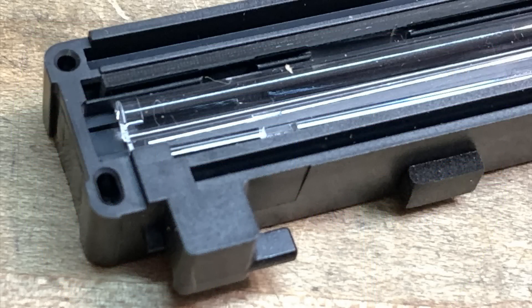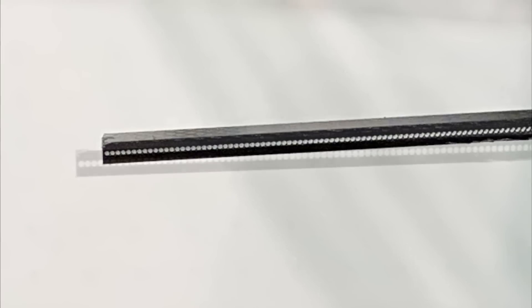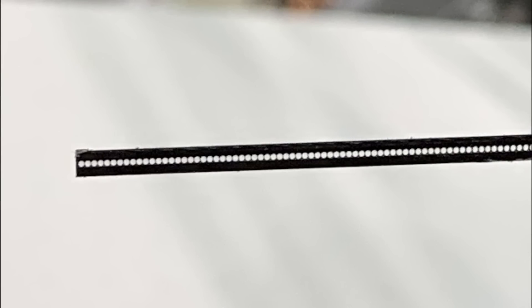If we take a look at the optic side of it, we will see that there is a black thing here that I've marked with a V. It's very difficult to figure out what that is and exactly what part of this picture you're looking at. But if we take it on end and show you a picture of it, you can see that there's just a whole bunch of little lenses. These lenses are special — they're called gradient index lenses. They're rods; these lenses don't look like curved lenses like you're used to. They're little rod-shaped lenses.